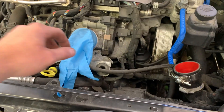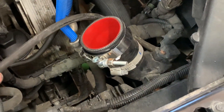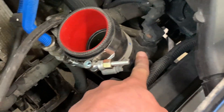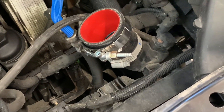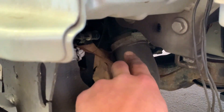I started early because I'm still waiting on my pipes to come in the mail. You can go ahead and start removing some of the piping. Right here you have a vacuum line, and also a sensor that plugs into the intercooler piping — this is attached to your radiator fan. I'm going to use this hard plastic tube; it downsizes to about a two-inch diameter. I'd like to run a full two-and-a-half inches but I don't feel like welding or manufacturing a mount for it. This hard plastic tube should run decently down and connect into the rest of the hose.